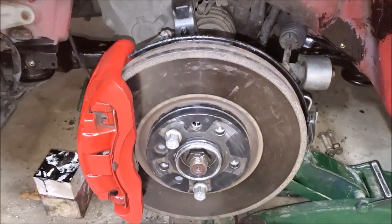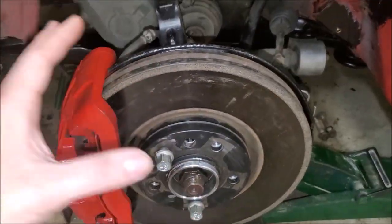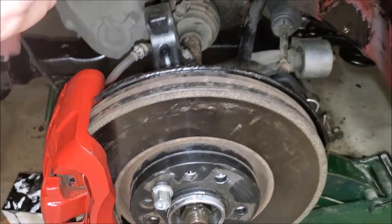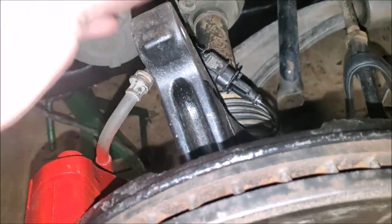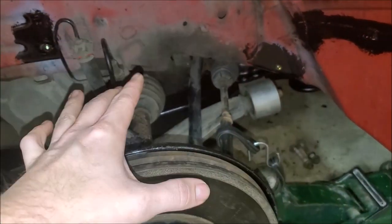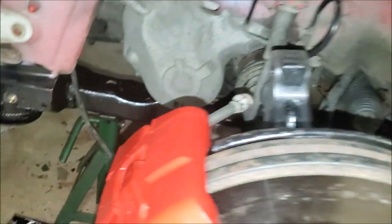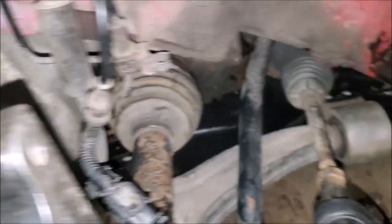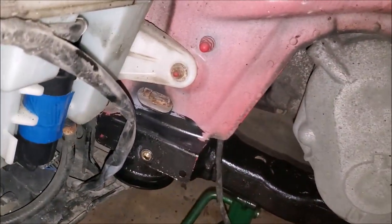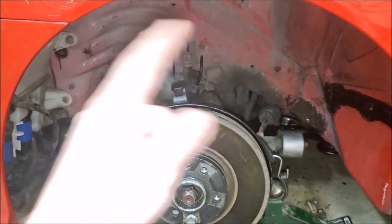Fast forward through time with a little movie magic. I now officially have the brand new wheel bearing installed, the original rotor, the pads back in since they're in decent shape, painted calipers on, new slider pins, old dust shield painted with POR-15, as well as the knuckle. The old control arm is just sitting in place — it's not mounted yet because I'm waiting on a brand new one. The strut's not in either, I need a new mount plate on top. As you can see, I POR-15 rust-proofed the sub-frame, right around where I did the rivnuts, the seam, in behind here, and up top of the wheel well. This is all good to go — we now just need to throw in the wheel liner and fasten the new bolts.